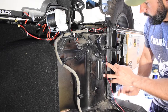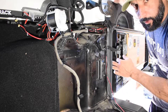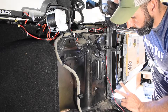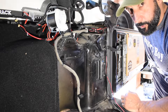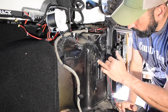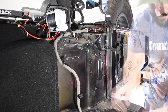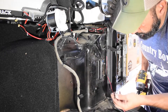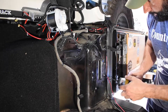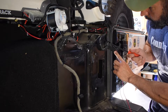I already removed my tailgate hinge right here — the one that connects to make sure the gate doesn't open all the way. My EVO spare tire carrier has stops on the other side so I never installed it, and some older Jeeps don't have them anyway. But regardless, you still need to take out these four bolts here and they'll be reinstalled back on the Goose Gear — these four bolts are also Torx 30. Now we need to pop these two zip ties out of the body.